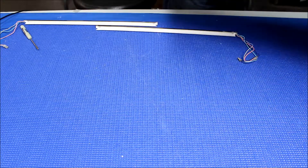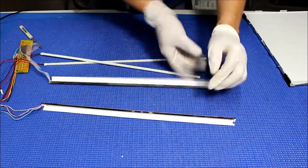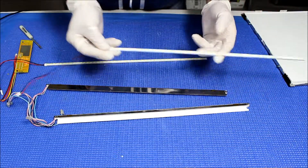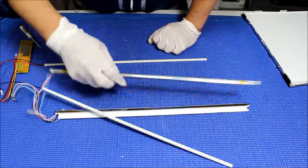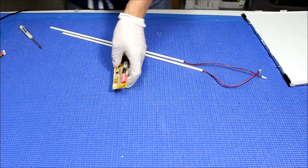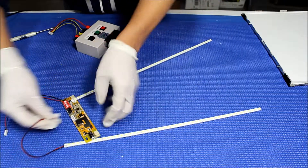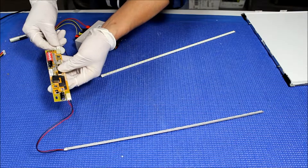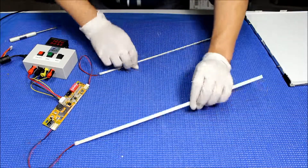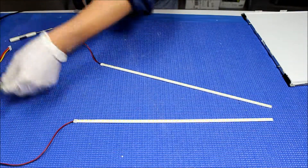I'm going to take a look at the LED kit — and the reflectors. These are the original reflectors. The LED is not going to fit inside the reflector, so we have to mount it on the edge on both sides. We can use this. First, we're going to test the LED. We apply power here — nice and bright. There you go. Two ends done.